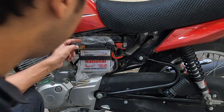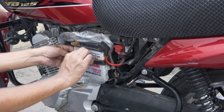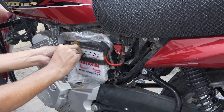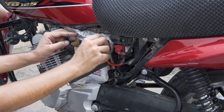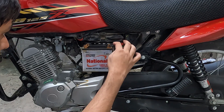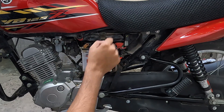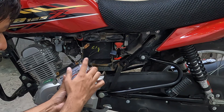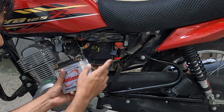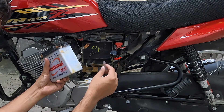To remove the old battery, you need a simple spanner to open the fastening bolt. Before opening, remove the rubber cover that has been packed around it. Open the hook to release it. Then open the two terminals of the battery — note that one terminal may be stuck or broken from corrosion, so be careful. Bring the old battery out carefully, as it is a water battery and may have extra gas or acid inside.